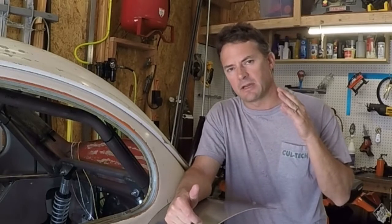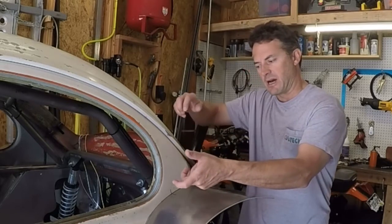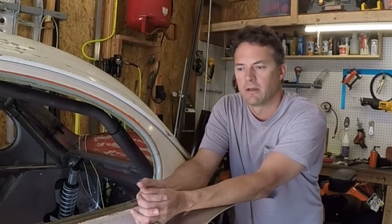It took a lot of attempts to make the wiring harness. I made the wiring diagram first, which helped me determine how many wires I needed going out and coming back. But honestly, I made the wiring harness three times — I would pull the wires I thought I needed, roughly install it, then check if I had all the wires, if I'd pulled them too far, and if I'd allowed enough slack from the distribution block all the way back to the engine compartment. I had to do that three times before I got it right. The wire itself came from a company called Wire Barn — I'll put a link in the description — and it's designated for automotive use.